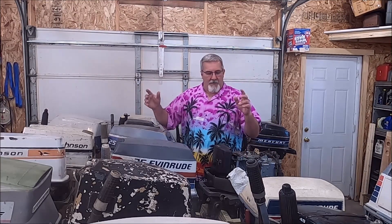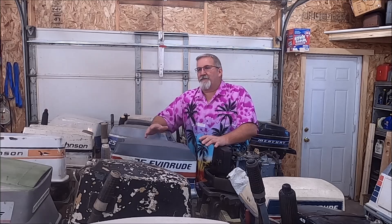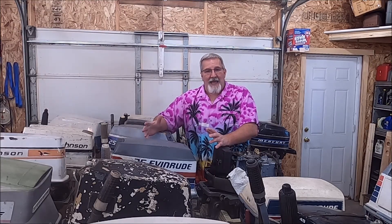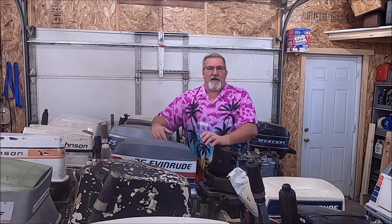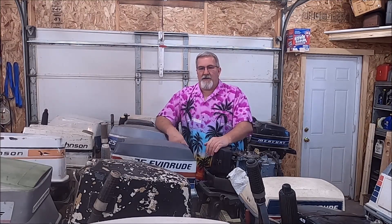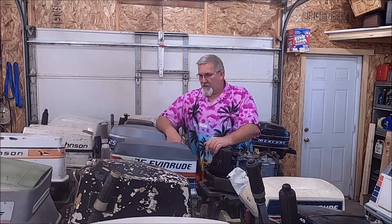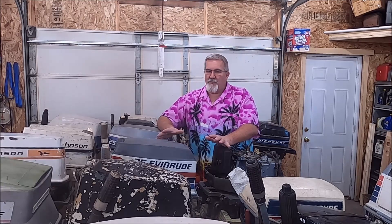I've got a great little six horse I worked on earlier this summer. If you have an outboard and you're going to let it sit for a long period of time, it's no different than a car or any other mechanical device — if it sits too long, seals start to go bad, things start to rust. Outboards are no different. You want to exercise these things occasionally. A wall hanger you haven't touched in two years might have corroded seals, gummed-up carbs, or ignition points gone bad from oxidation.